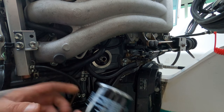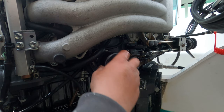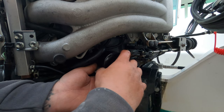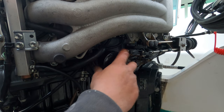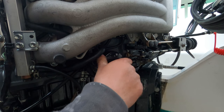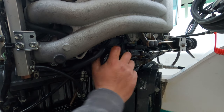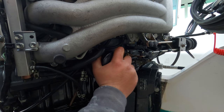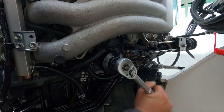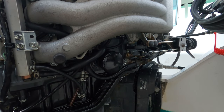This is ready to be refitted. I've cleaned everything all around here, got all the old oil off. Same again with cross-threading — thread it in the centre like that. As you can see, that's spinning on nicely by hand. I've got oil on my fingers and I'm still screwing it in — oil on my hands is slippy — and there's no resistance there. Now I'm coming to bottoming out, nearly all the way in. Get it tightened up and that's the oil filter done. This doesn't need to be that tight — that's enough, right there. That was probably a quarter of a turn.